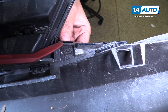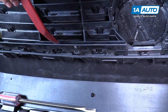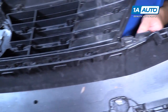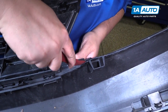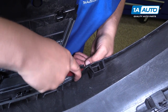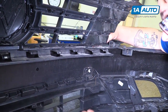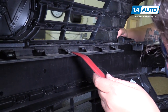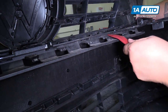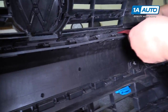On the grill, to remove it, you have these clips here, here, and then underneath there are ones right here and here, and they go all the way across the bottom of the grill. You're going to want to take a plastic pry tool and pry up on the ones on the side and force the grill forward to get these clips undone. Then on the ones underneath, you're going to want to force the section down with your plastic pry tool and push the grill forward. This is going to have to come off in one fell swoop — the grill will be very stiff, so clips will only come out very slightly as you go along the edge of the bumper.